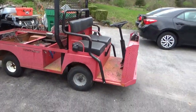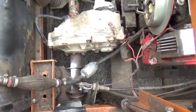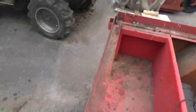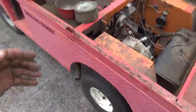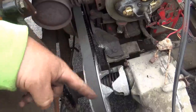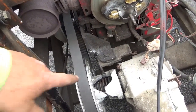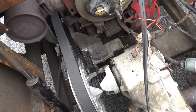Okay tubers, here it is on all four wheels. I did manage to cob that Yamaha golf cart rear into it. See how far that wheel is in, and see how far this wheel was out — almost flush. I really had to move the transaxle this way because if you don't keep the belt kind of straight, the belt would have a tendency to idle and drag along. And also as you gave it more gas it expands and would scrape things, so I had no choice.